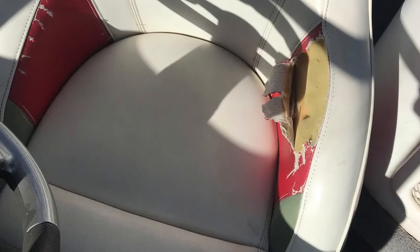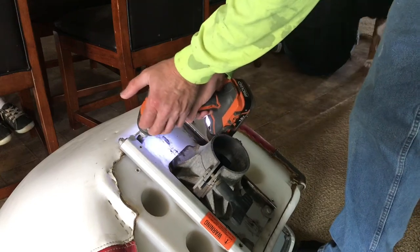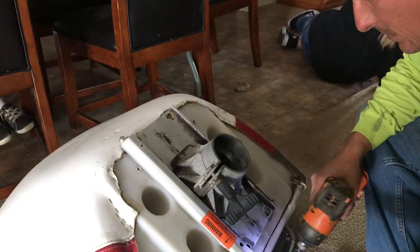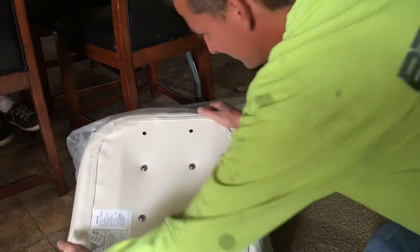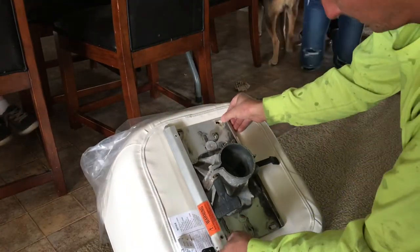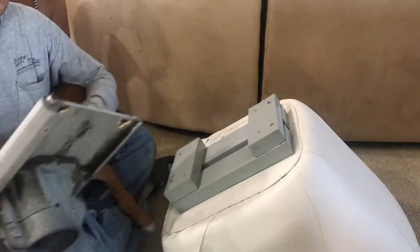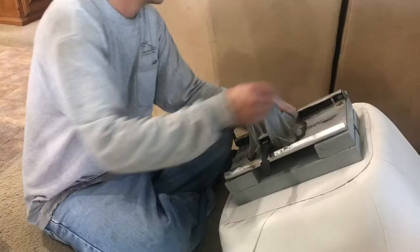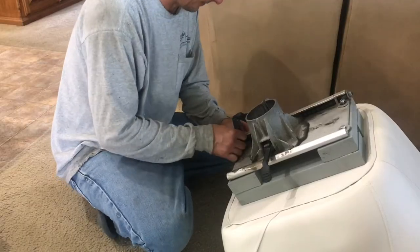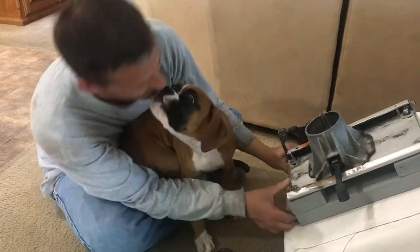As far as the captain's chair goes, my upholstery guy said it would be cheaper just to buy a seat than to redo the old one because it's very labor intensive and the upholstery is still expensive. So I removed the four bolts holding the base plate to the old chair and got a captain's chair off Amazon for about $200. One thing I didn't consider was the height difference — the bottom cushion of the new chair was about three to four inches lower than the old one, so I had to make a spacer block out of two-by-fours to sit between the base plate and the chair.